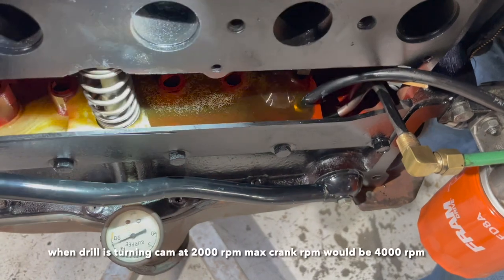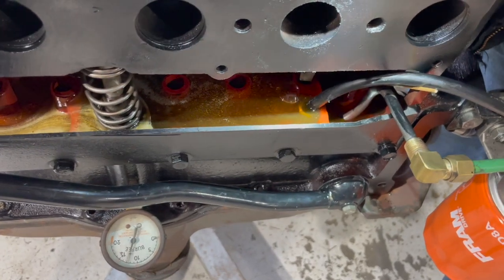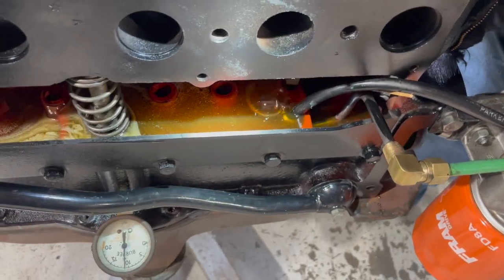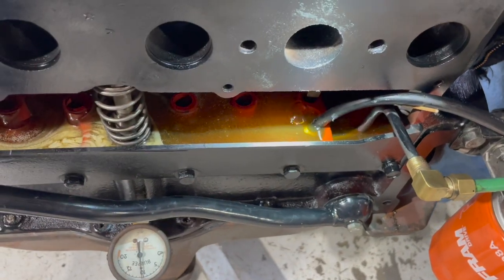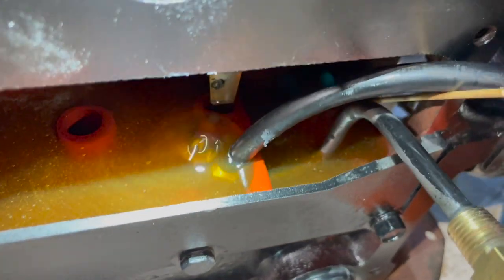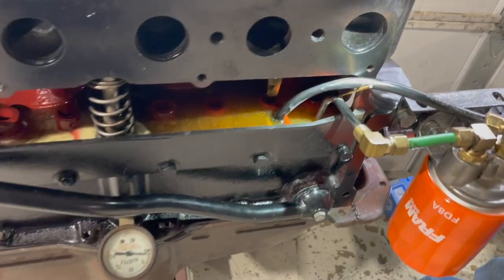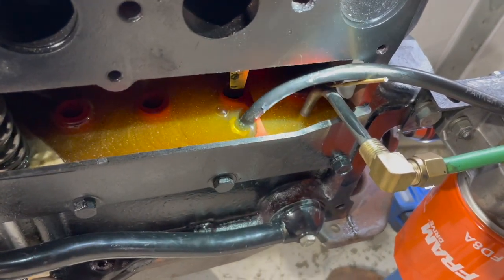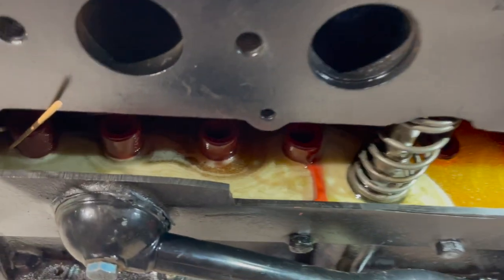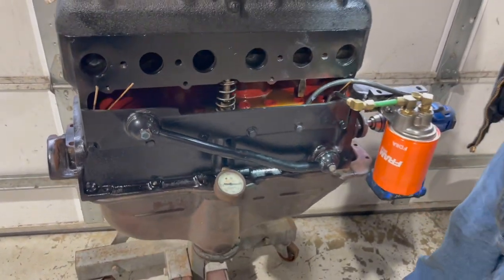You can see it's filling the oil chamber up. Right there — that's actually at about 1,000 RPMs like it would be out there. It is filtering 100% of the oil because there's no oil coming out around the tube where it's slipped up into the oil galley. And that was my main object of doing this test — to see how much oil really was being filtered.